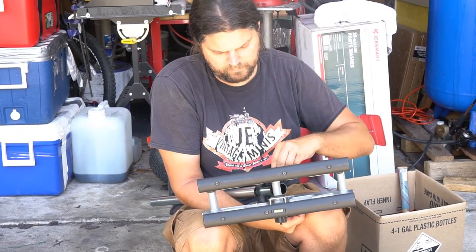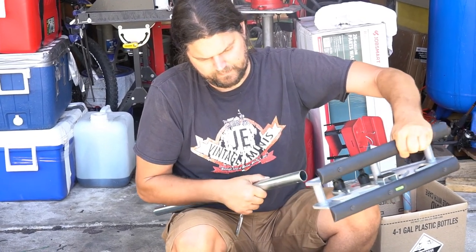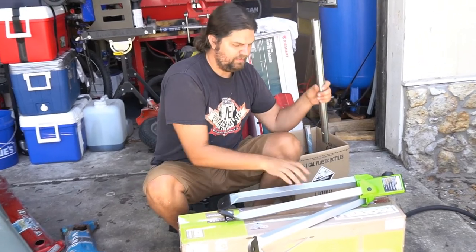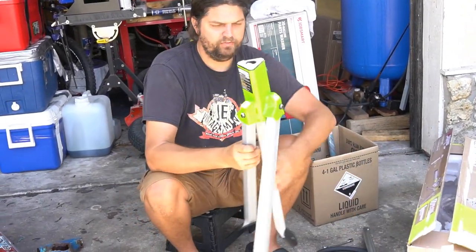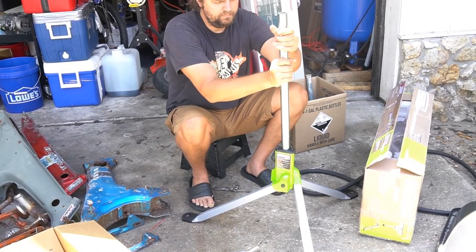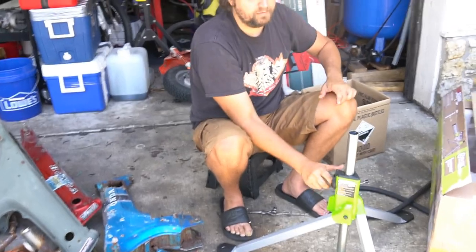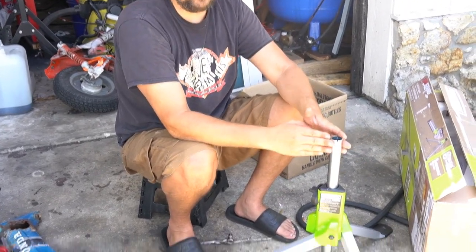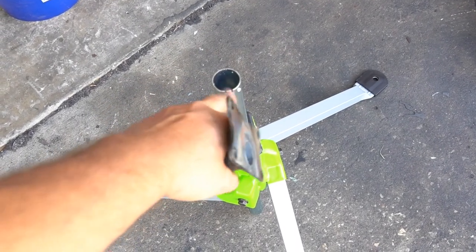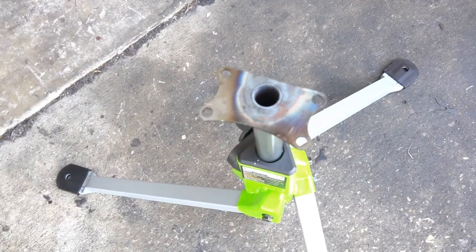It's a 10 millimeter bolt and nut. You'll just save that for later — run your bolt back through it and keep that on the side of your garage or in your closet. I'm going to go ahead and put the stand together. I have that slip-in part that's going to go here — I'll show you that for the engine mount. That's basically the breakdown of the Rockwell jaw stand to get ready to use it with these Honda bikes. This is the slip-in part: just a long extension tube that is close tolerance to the inner diameter of this tube. It slips right in, it's not going to go anywhere. Rotate, and then you've got the holes that mount at the foot peg area on the bottom of your engines.